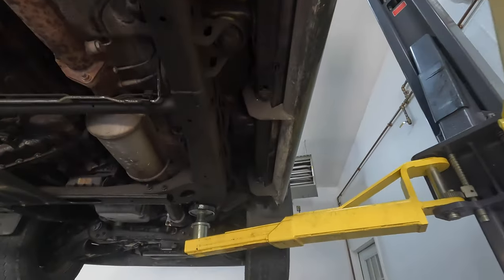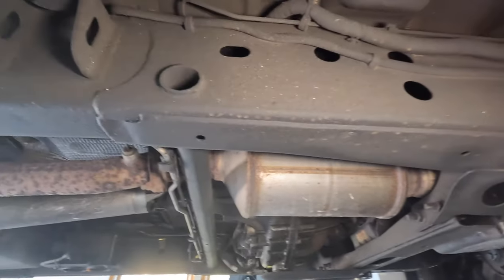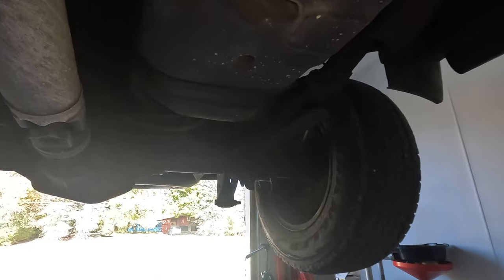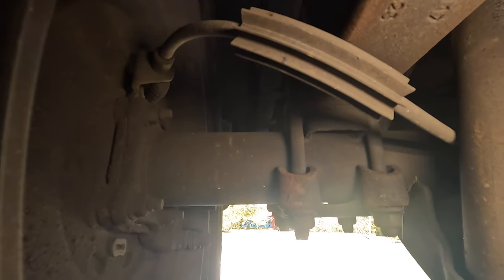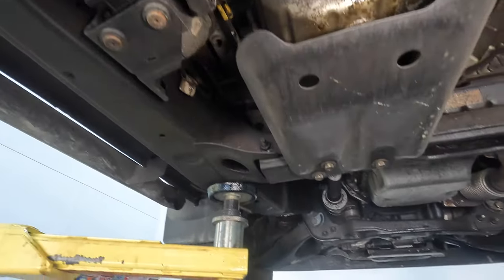Up in the bedsides and the rockers, nothing has changed. As far as Surface Shield, Fluid Film, and the other products on the market — Surface Shield obviously works. The front of the axle has always been a problem area for wash-off, and as you can see there's still a bunch of it on there. As far as rust is concerned, it's pretty minimal — there's a little on the bracket for the u-bolts, but overall I don't know what else you could expect out of a product. It's about as good as it's ever going to get.